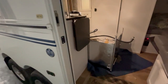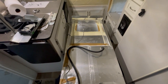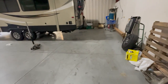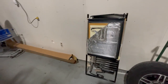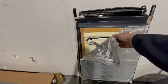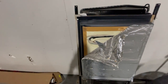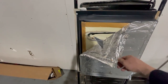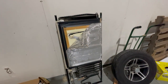On this Escape, you saw where the cooling unit was out of this refrigerator and it had a problem. We actually found it was still within the Dometic warranty period, so we were able to get a new cooling unit. But let me show you something — this comes back to a video we did called the Dometic RM1350 debunked; go back and watch that if you haven't. This tinfoil keeps that from working correctly. All of this thermomastic needs to be against those coils in that refrigerator. When you cover that up, that refrigerator is not going to transfer or absorb the temperature correctly. This is an OEM unit, and this cooling unit is only two years old.